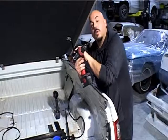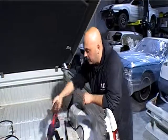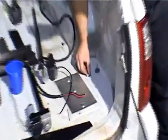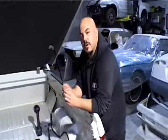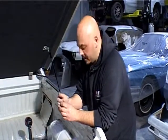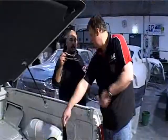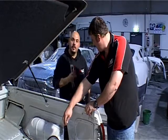We've now got our 9mm drill bit, and grabbing one of the bolts from the kit, we can just make sure it's the right size. These bolts from the kit are really long, so depending on where you put them, once you know where they're going you can trim them down to whatever size you need. We also put a large washer on there to help disperse the weight underneath. These things are ready to bolt on. Brett's going to hold the bracket, I'll get underneath with my torch and ratchet, and we'll bolt this sucker in.